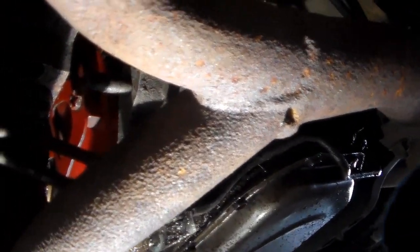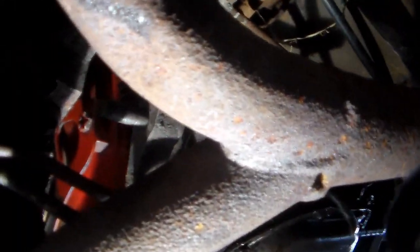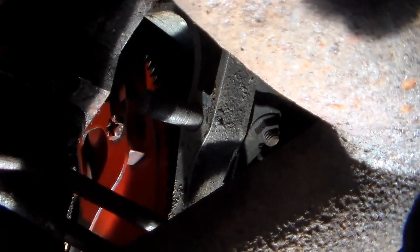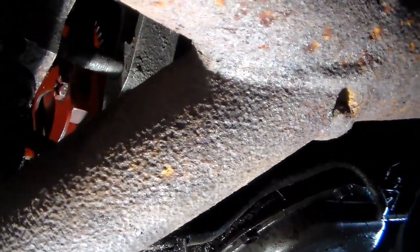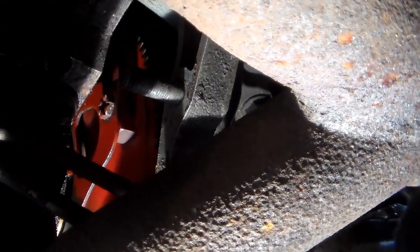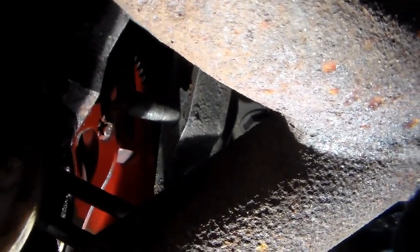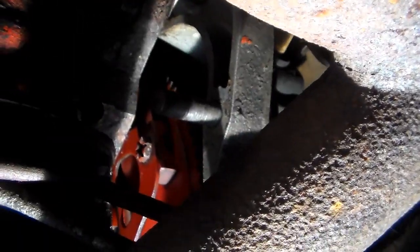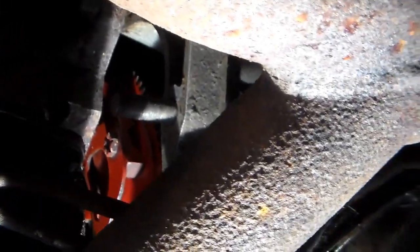That has to come off. So that's off. Wasn't easy with it in there, but it'll come off. And then simply what I do is I rotate the engine until the flex plate bolts, I think there's 3 on this, 3 or 4, doesn't matter. Anyway, take them out to leave the transmission in it. But you rotate this engine until you get it with that thing adjacent to the block right there. You can see that's the edge of the block.